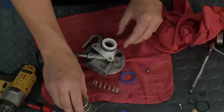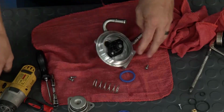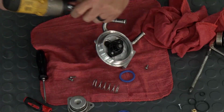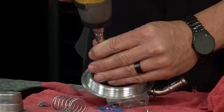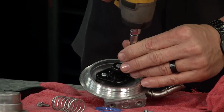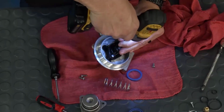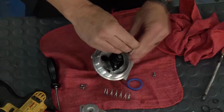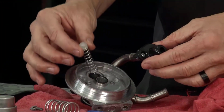All right, now we can just put this back and torque it to specification, but there's a couple seals I want to show you on the bottom. So if I go to the bottom here and I pull off the other portion down here, 2 Torxes down here, 20 Torxes once again, and then be careful here as well. All right, a little bit of spring pressure right here and a check ball. You can see it right here. The little check ball, be careful, take care of that.